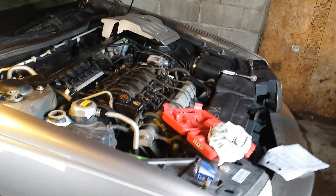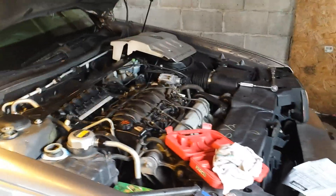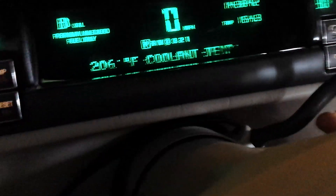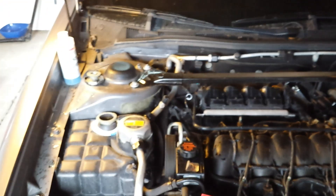I know that I'm going to be spending a few hundred dollars on the spark plugs, plug wires, and tires. I just got the oil changed with synthetic today, and tires have been rotated and balanced. I'm going to go get an alignment. I want to know before I go dumping this kind of money into this car that I'm not putting good money after bad. There's no sense putting work into a car like this if it's got the notorious head gasket issue. And if I ever need to sell it, I can vouch — I have proof that the head gasket is good. I ran the kit on it and we came out fine.